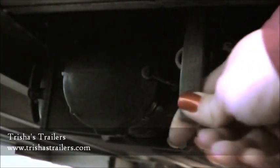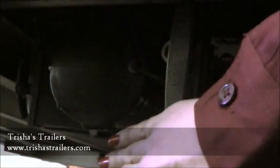Here are your holding tanks. This cap here goes first — take it off and put on your sewage hose. What you want to do first is actually empty your black water tank. Just remember: number one, number two — pull this rod out and your sewage will come out. Push that back in, then pull the rod for your gray water, so it actually flushes out the tube. Then push that rod back in, take your sewage hose off, and put your cap back on.